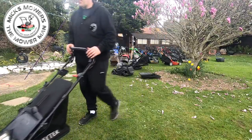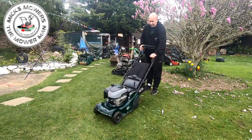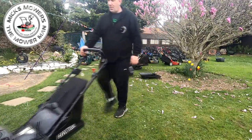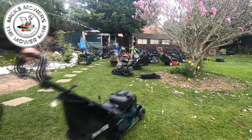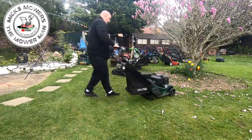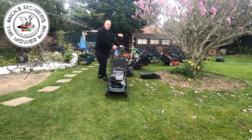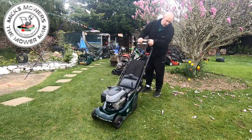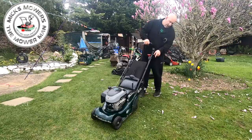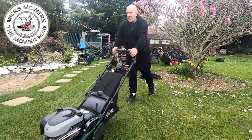Yeah, I think the chain's slipping. Feel it. Yeah, that works. But there is a slight catch on it. I think it is that chain. I can hear it. And it catches there. I think the chain's slipping slightly. But it drives. See that clunking? That's it. Clunk, clunk, clunk. So the chain might be seized on one of the links. But I'll investigate that. That's no drama.